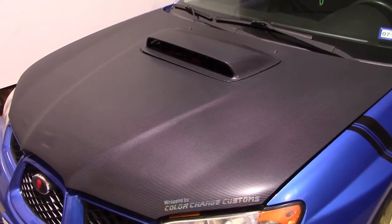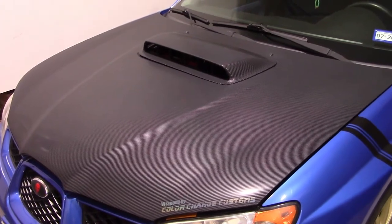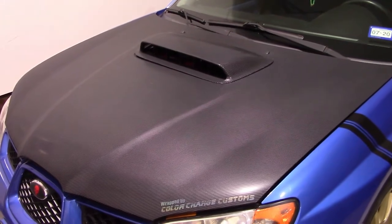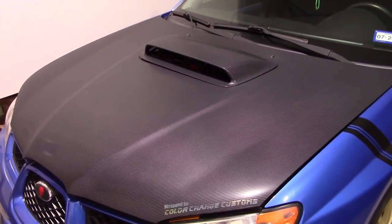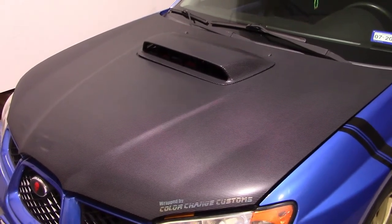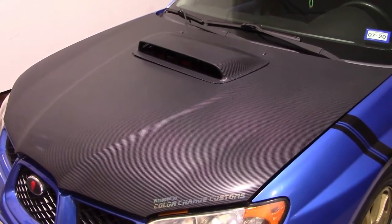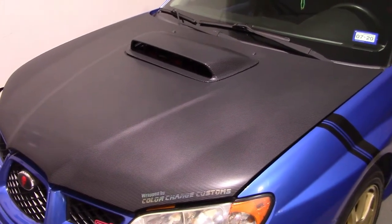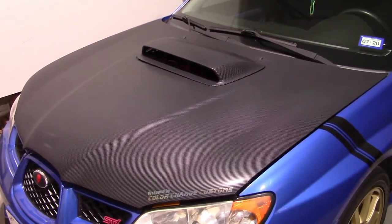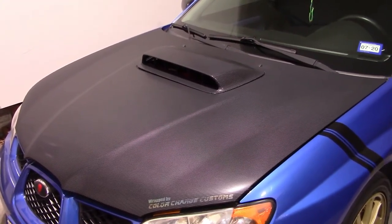In order to pull this off, you're going to have to use a little bit of elbow grease and heat to assist. Right now it's only about 50 degrees in my garage, and vinyl wrap when it's cold is pretty brittle. If I try to pull it while it's cold, it'll be very hard to come off and will basically chip off into chunks instead of pulling off as a big sheet. So add a lot of heat - a heat gun, a torch, IR heater, hair dryer, whatever you've got available.